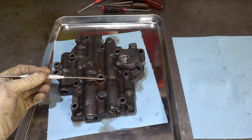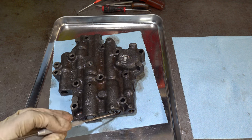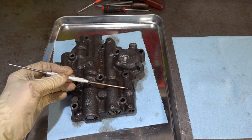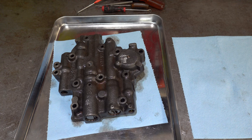And this is going to be your 2-3 valve train. So 2-3 shift valve inboard, and then your 2-3 modulator valve sleeve, spring, and roll pin. And then over here you have your 3-2 valve, your what's called a 3-2 pin, and then a bore plug, spring, and a roll pin.